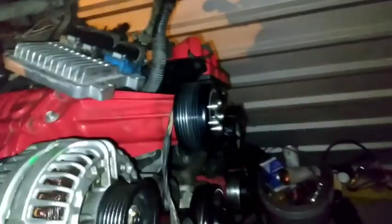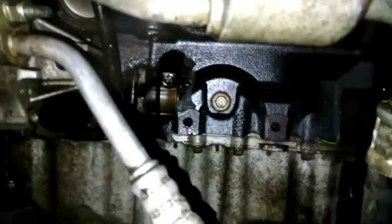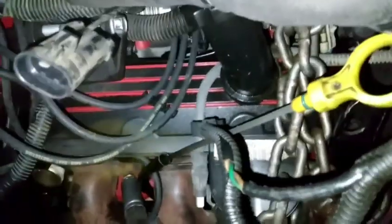They have a little bit bigger valves, and I'm going to go ahead and just use these since they have the bigger valves. And so since that front one that's on this engine that came out of the 06 that just blew up, ever since I did the top swap, it's had a cylinder 3 misfire. Since the day that I did the swap, it's had cylinder 3 misfire. And that's exactly where it messed up the block. Cylinder 3. There's cylinder 3. Boom. But, so, I'm pretty sure that this front head has some issues with it.